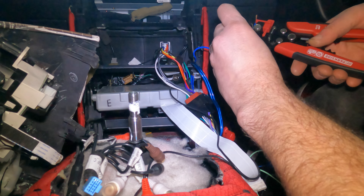I haven't bought a DAB aerial — I'll do that another time. We've got a normal aerial and a microphone. I need to replace the microphone because the current one came with my old Android head unit. It runs all the way down through the car, across, and up into the centre console. So I've got the old microphone out and I'm going to run the new cable and cable-tie it out of the way. Refitting the new microphone — it's got a 3M sticky mount and a large clip we might use.